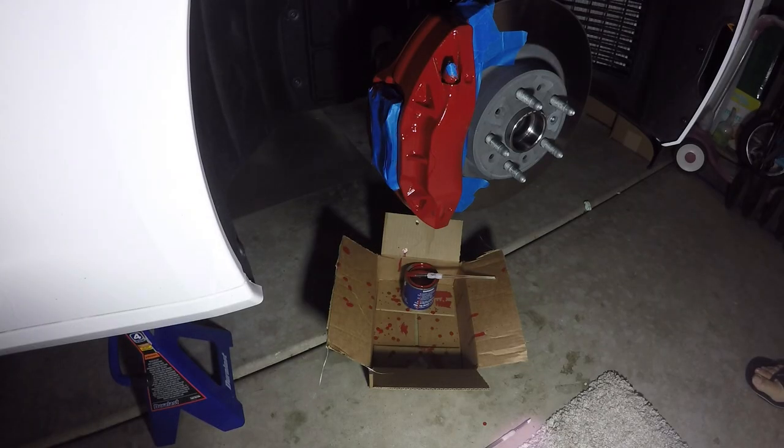Okay. It's getting a little cold where I'm at night, and so the paint isn't setting up as quick. So I'm probably only gonna be able to do 3 coats. And instead of the 15 minutes in between, in this instance, I actually used a little bit of a heat gun to help cure the paint a little bit. But I'm gonna try the 3rd coat, and just gotta be really careful that I don't create a whole bunch of drippy, drooly paint. So here we go.